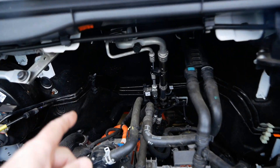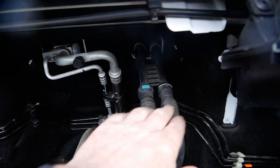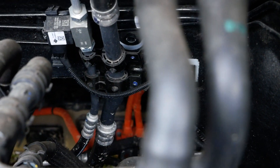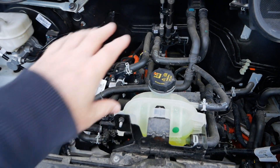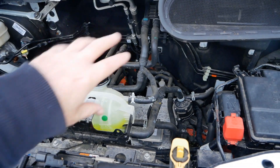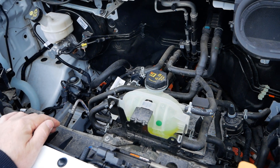Here are your brakes and brake reservoir. The main things you'd open the bonnet for are your windscreen wash and the two coolant bottles. There's also a fuse box, the air intake for the heater, air conditioning lines and coolant lines going into the heater system through the bulkhead. Down there behind it all you can see the front of the battery pack with those orange high-voltage cables going in, and the coolant lines going into the battery pack as well. Even though there's quite a bit in here, there's still an awful lot of space compared to the diesel version, which should help with crash protection.